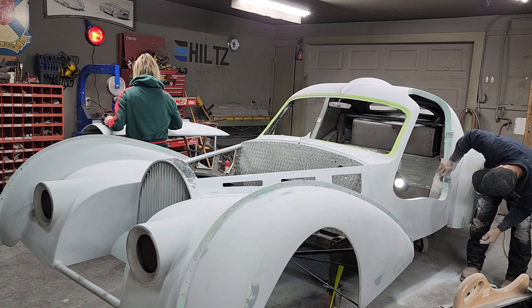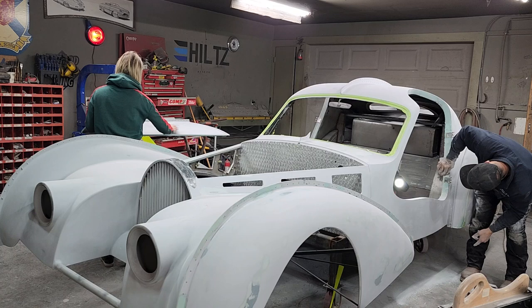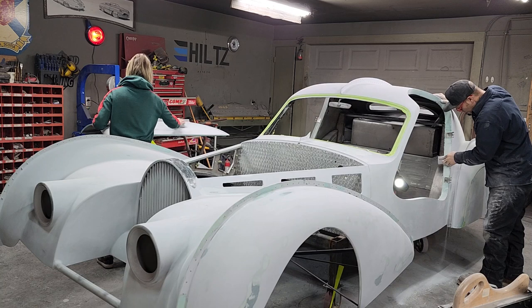I guess you find out after you do it. You can listen to me, you can say it's the wrong way or whatever, but putting filler over top of filler means you're sanding the filler that you already have there. Pinholing after seems to be easier.